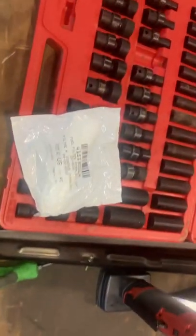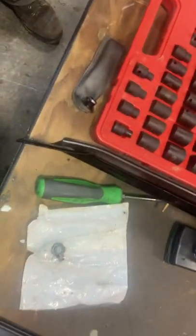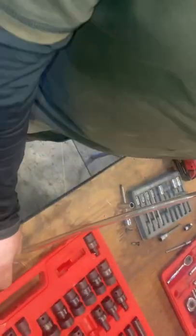He's going to pop that sock filter off — just grab onto the bottom here and it pops right off. We're going to get the new one, which is part number 0691. Last time we screwed up and got the wrong one. The old Expedition or Summit ones, a bunch of them use these filters, and when we did this last time we realized they'd changed the design. The new one just slides on, pushes right on — pretty simple. Then the bottom of the fuel cartridge folds up and holds it all together.